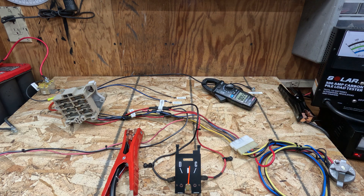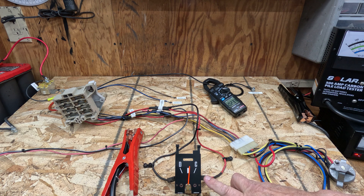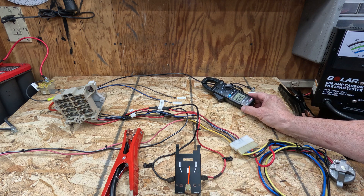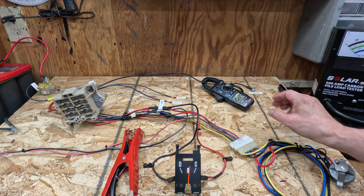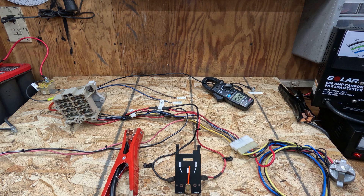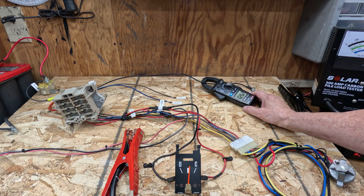Watching over here — we're seeing our five amps going to the battery. Let's bring in about 20 amps. Dialing up to 20 on that ammeter on the power supply — this gauge isn't real precise. You'll notice the ammeter is still showing our four or five amps of charging current to the battery. Total alternator output at the moment is about 22 and a half amps — that's charging plus the load we're placing on the ignition system. Dialing a little more — there's 26 amps total.